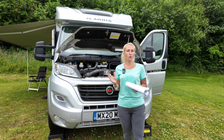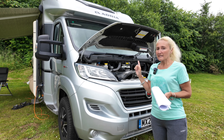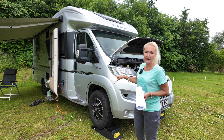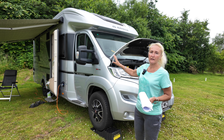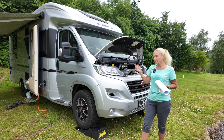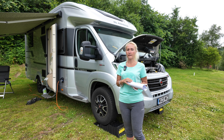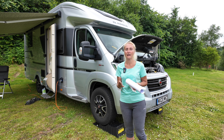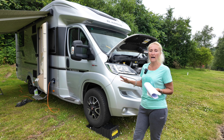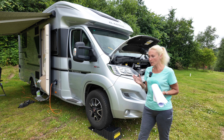Why might you want to uprate or upplate the weight of your motorhome? Simply because sometimes that payload just is not enough. As well as your gross vehicle weight, the plate will also tell you the limit your axles can weigh — you'll have a front axle and a rear axle, and possibly a tag axle on a bigger motorhome. When we went to a weigh bridge we were quite shocked. Our gross weight should be 3,650 kilos but we were already at 3,500 — only 150 kilos to play with, with no water, no clothes, no food, no e-bikes, and we were really close on that back axle. There's a link to that weigh bridge video in the description. We were a bit concerned, so I got in touch with Cara Motorhomes and asked about upplating.